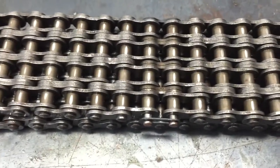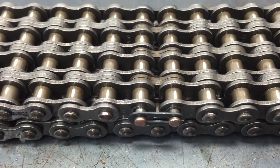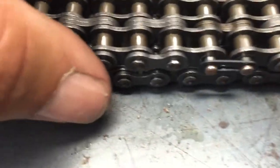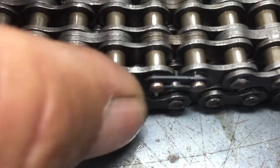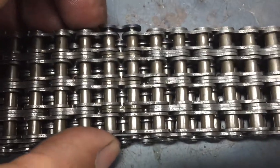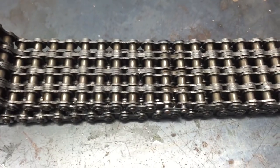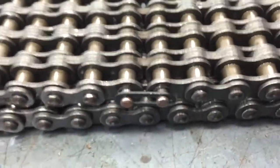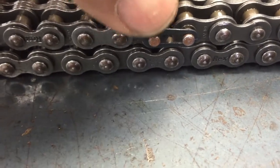It's an interesting little bit here from a previously rebuilt engine/transmission. This master link — generally Indian Chiefs use an endless chain, and there's no point in having a master link in it because you can't put it in and out once it's in the bike anyway. So they'll just use an endless chain — it's one less thing to go wrong. But in this case somebody's used a master link and hasn't put a link plate under here. You can actually see how far it just goes backwards and forwards. This thing here is just going to be a catastrophic failure — once this fails it takes out the whole inner and outer primary cover. So always try and use an endless chain, but if you do use one with a master link, it must have a link plate underneath it.